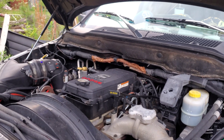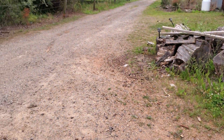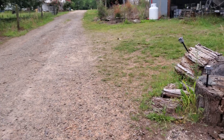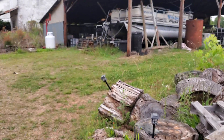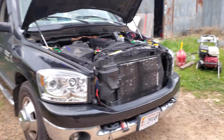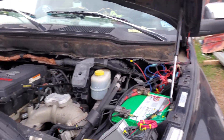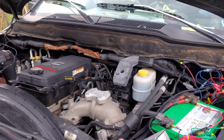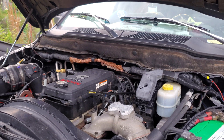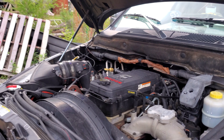But I found out you've got to know how to burp your Cummins. I've got about a 25–30 degree slope, so I pulled the truck up so the bumper was right about where that pole is, made sure everything was topped off, and revved it to about 2500 RPMs. You could almost hear the bubbles burping out the overflow, and then all of a sudden I had heat in the cab.